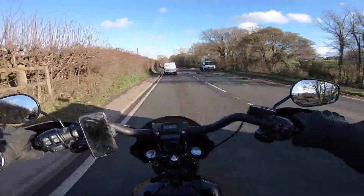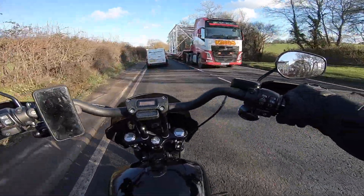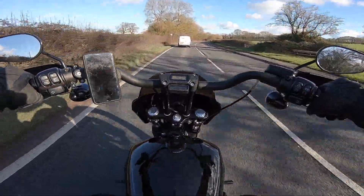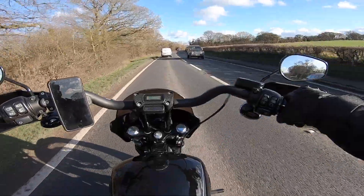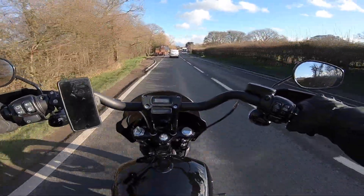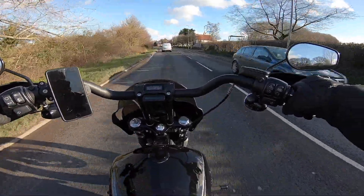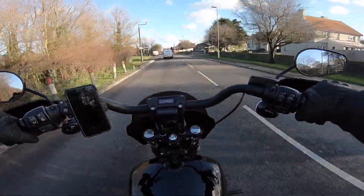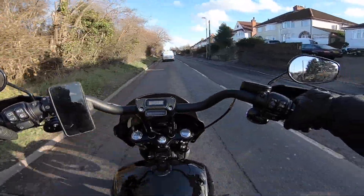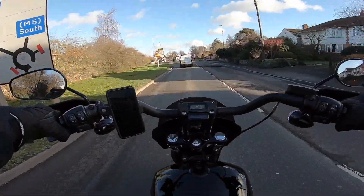Not zero degrees with snow in the morning — that's probably not the best conditions. It's more of a safety thing than anything else. These tires will run in in damp or wet conditions because they're still rubbing against the road, but with brand new tires you want to be safe, and if it's dry you're going to increase your grip already. So try and pick a nice warm dry day, warm those tires up, get on the bends, and progressively wear them in. I've done 80 miles and they still feel pretty slippery, so I'm going to give it a good go on the bends when it warms up and dries up a bit.